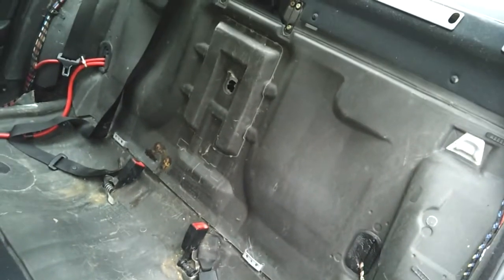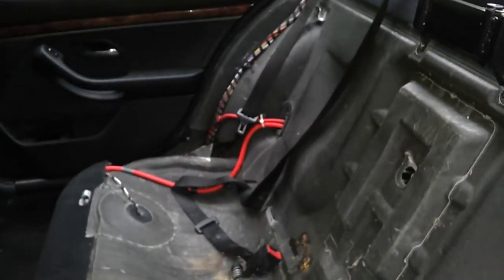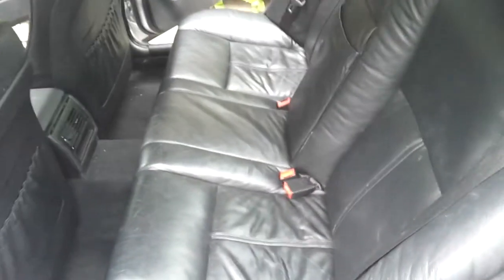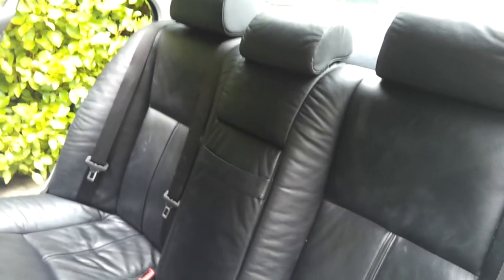Now we have to move to the backside. What we have to do is locate one, two, three, and four clips that the seat has to catch on, and there are two small 10mm bolts, one on each side. As we can hopefully see, that's our rear seats in. It's pretty much the interior done — I still have to do the door cards. Seats are in and bolted in. Back soon folks.